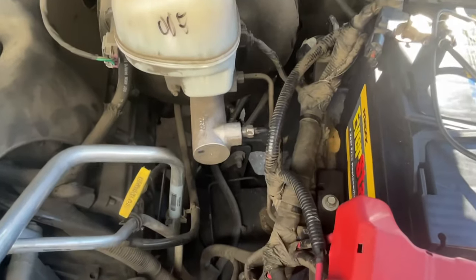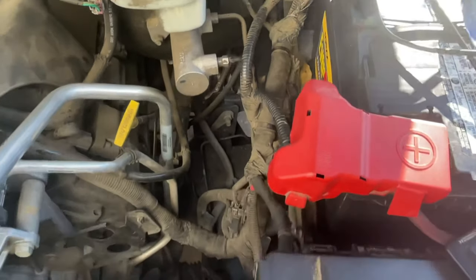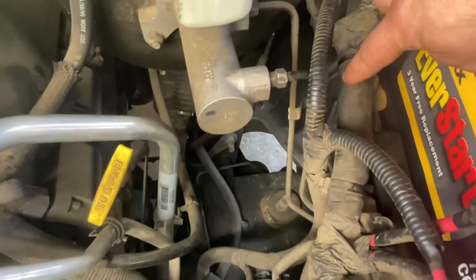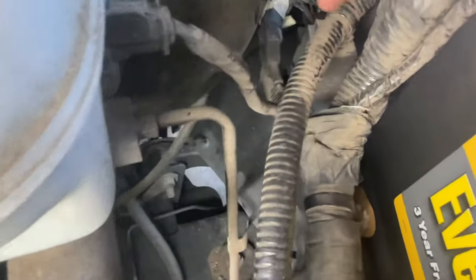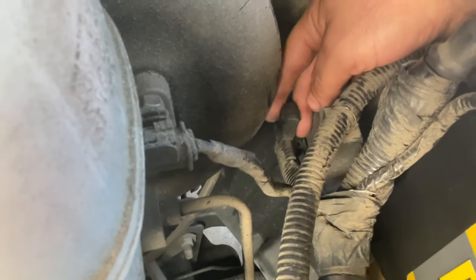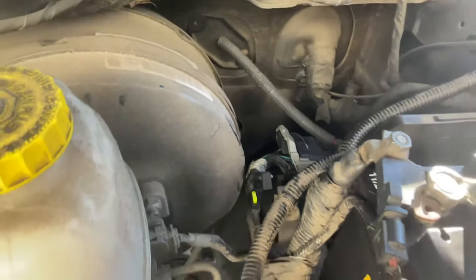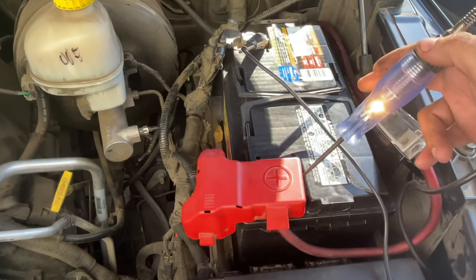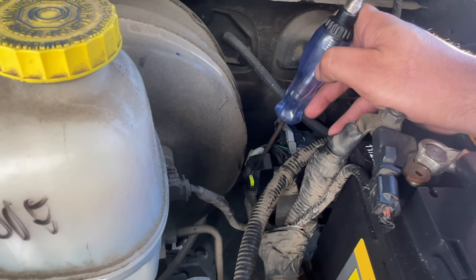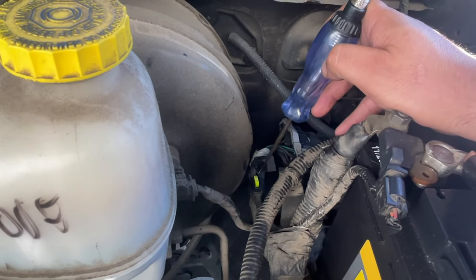So always do your research. When I was reading the actual forum, they did say that they had a radio fuse that was external to everything, and it was on the power side. So you've got to run through this wire right here. Some of them are right here, but if you keep going a little bit further, look what we find right here — this looks like something external, like they just put an external part right here. But if you open this up, there's a 20-amp fuse right there. Let's get our test light and verify it works first. We're going to check one end of the leg — there you go — now let's check the other end, and there's nothing there. One end, other end.